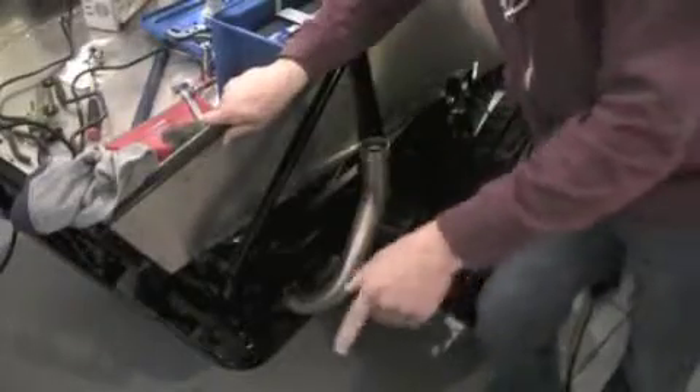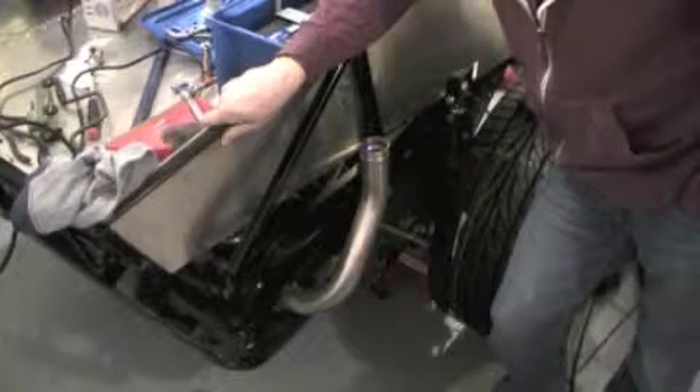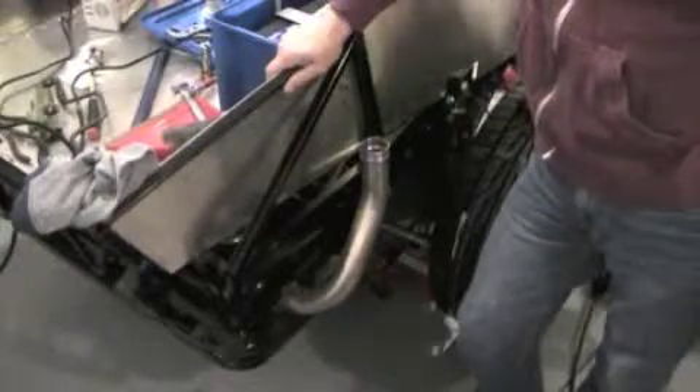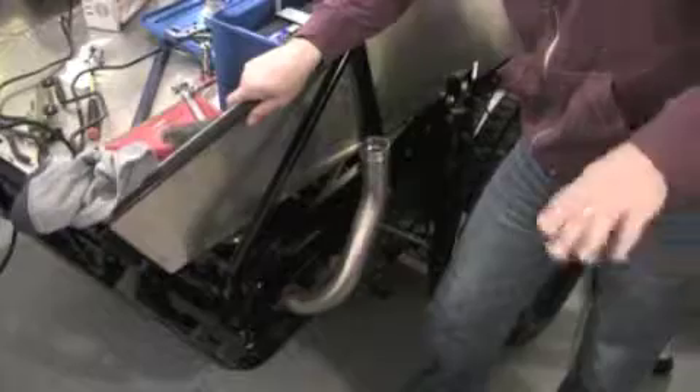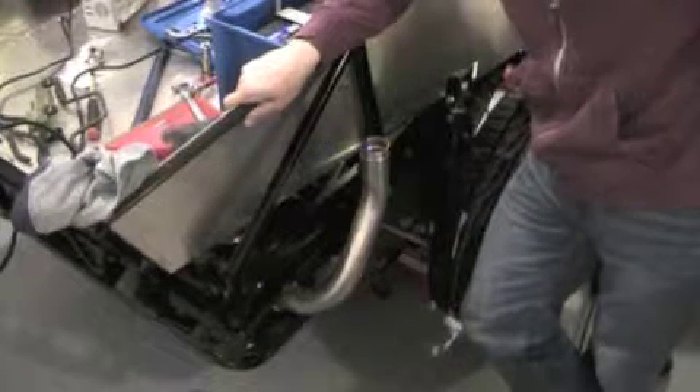Now, in some other jurisdictions that require a rear bumper, this really throws a lot of guys for a loop because a rear bumper on the outside of this car would look very much out of place. The solution that a lot of guys have found is to weld a bar inside the rear frame — just a four-inch by two-inch stock the width of the back — and that usually does the trick. You do it down low and you'd have the whole perimeter covered. If you're in a jurisdiction that requires bumpers, that's a solution, but you might want to talk with the regulatory bodies and clear it with the inspector in your area first.